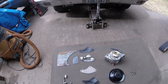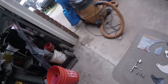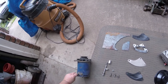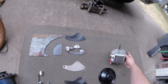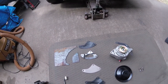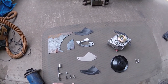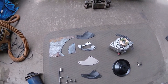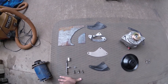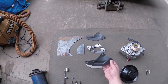Here's the update on the 3G swap — ditching the old alternator. Going from a whopping 35 amps to the 130 amp Ford unit. It's pretty easy to do. The biggest thing is your bracketry. Your choices are to either eBay it, and you'll wind up with brackets that won't work — creating a nightmare. What I did was figure that using the factory components would be less of a headache.